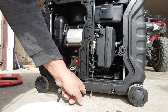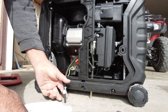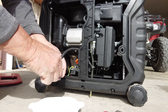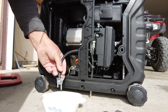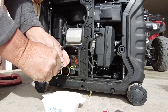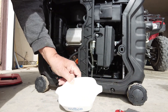Instead of having the hose drain outside, I put this hose on it with a shutoff valve. So when I want to drain the carburetor — and again, I don't have to take this side off, I've just done it to show you — I've got a little shutoff valve. There's probably better ones out there but this is the only one I could find. Take the cap off, turn it on, and drain the fuel. This is draining the fuel out of the carburetor so there's no fuel left in the carburetor. Then I can shut this off, put that back on, and store it inside here. I can get at it through this door pretty easily, and I've drained the carburetor.